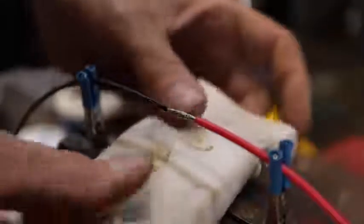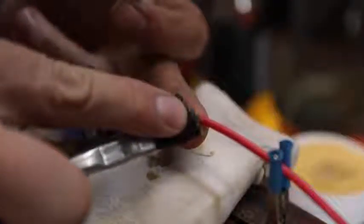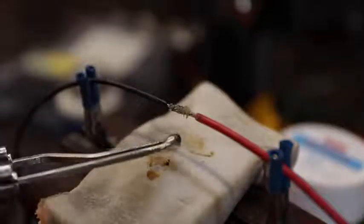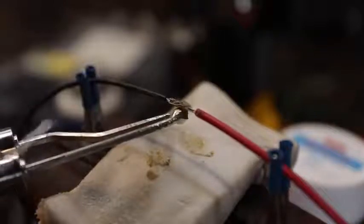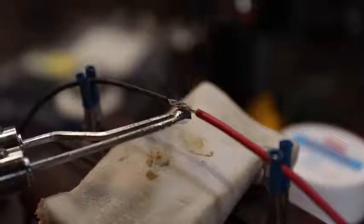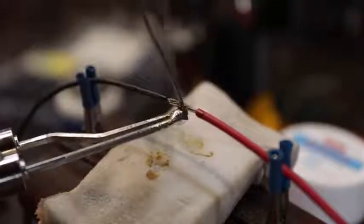You'll also want a damp sponge — just any old worn-out sponge is fine. With everything ready, take your rosin flux and apply it on there like that, coating it so the solder will bind. It probably wouldn't be a bad idea to have heated the iron up first. Get your soldering iron and we're going to put it on there just until that flux starts to melt and the rosin starts to melt down inside the wires. Granddad always said to touch the solder to the tip to tin it, and we're going to heat from the bottom.